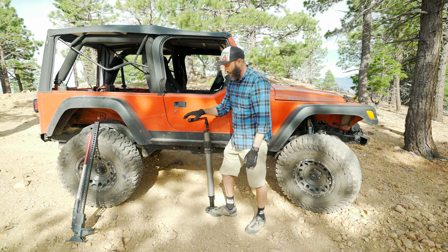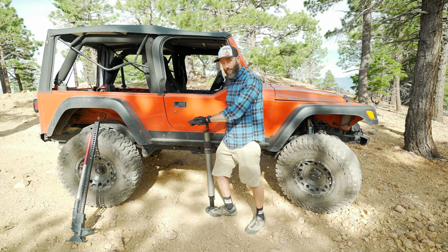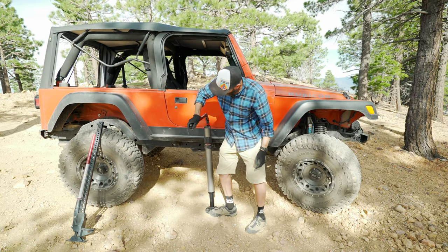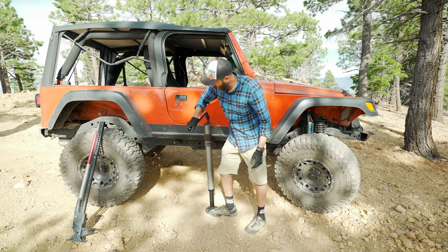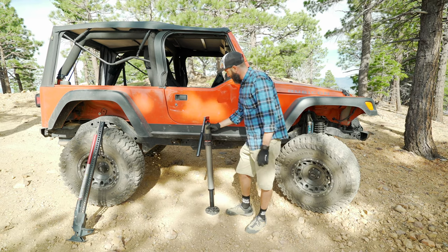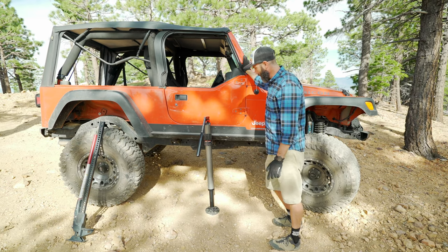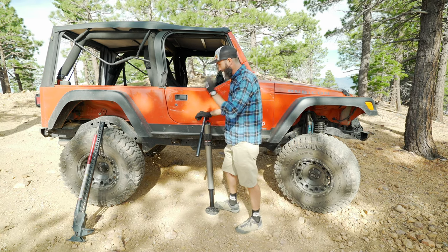You've got to pick the handle up rather than having it spring back — and if you've used a high lift jack, you'll know how important that is. It goes up and we've almost got the back tire off the ground. Yep, back tire's up and it's really stable. You ordinarily wouldn't want to try shaking the vehicle with a high lift jack because they're just not stable. I'm actually a bit worried about that high lift jack just falling down on the tire there.